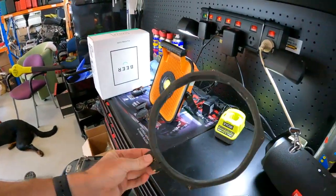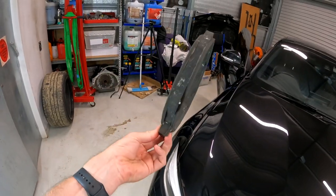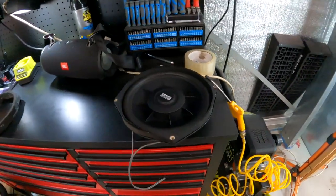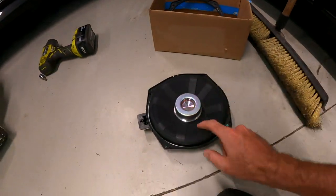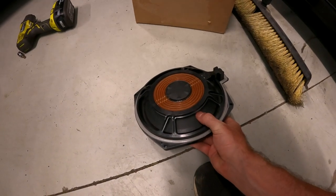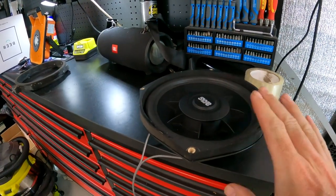Getting the subs to actually fit in — if you slide them straight down into the original hole, it'll actually bottom out, so you do need one of these spacers. As this had already been fitted to a 1M, we have the spacers to make it work. This will actually raise the speaker up by that amount, giving it clearance to the bottom of the factory sub box — but what you do run into there is the carpet is now very close to touching the cone. It's not a problem on the original speakers because the top section doesn't actually move, so the actual part that moves is the cone on the back. If you're going to do this install, make sure you have spacers on the bottom and on the top to protect the cone so it's got movement and it's not going to be touching the carpet.